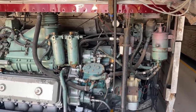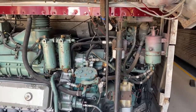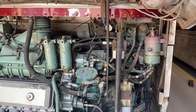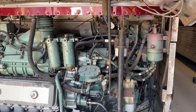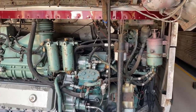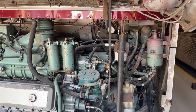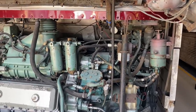That's all coming from Luke at US Coach. Once we get those fixed up, the fourth air leak is in a fitting — somebody added on a multi air chuck fitting, like to add air hoses to fill it up, and one of those fittings is leaking. So we're going to take that out and redo that fitting. That should be fine.